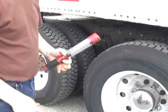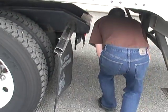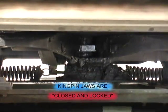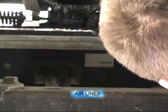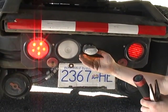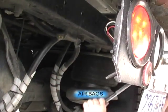I picked up my flashlight. The mud flap is secure. No daylight between the fifth wheel and the trailer. The kingpin jaws are closed and locked. All airlines inside the frame rails are secure, no damage. Left turn signal works. The right marker light works. Our license plate light works. The plate is secure. Both airbags are inflated.